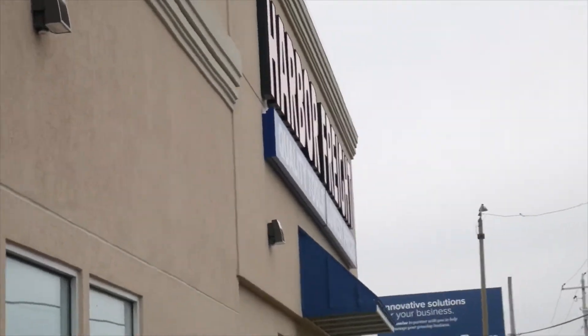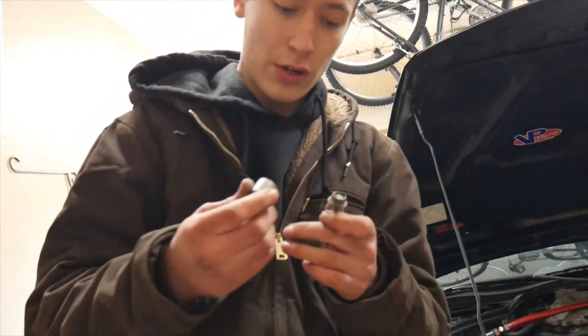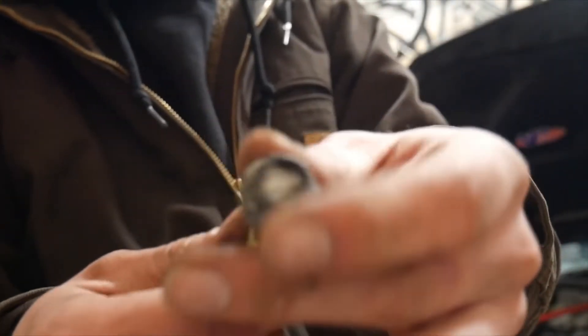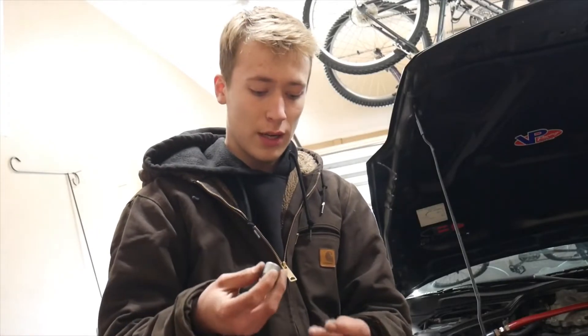As with all great car projects, a trip to Harbor Freight is necessary. I couldn't get a good enough weld on that bolt because of the location it's in, so now we've got to get a bolt extractor set. Found our goods. I've never had one of these bolt extractor kits before, but they're awesome. The socket cuts into the bolt, so the bolt head gets grooves cut into it — it actually worked really well. I'm glad I have a kit for these now, it'll come in handy in the future. Now I just gotta pull off the four mounts that hold the trans to the bottom of the chassis and then it'll be ready to come off.